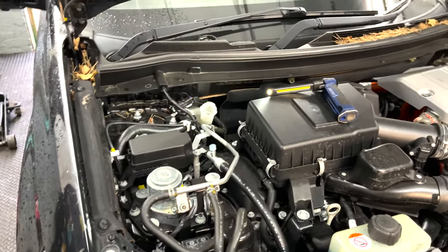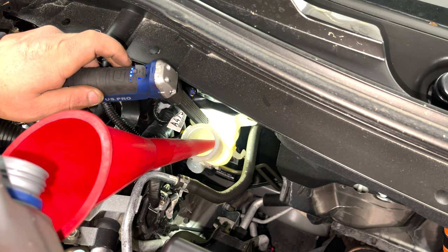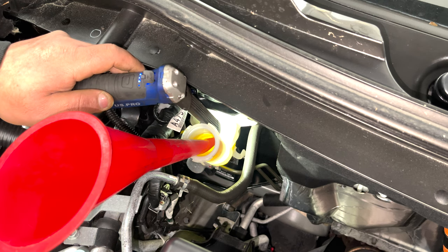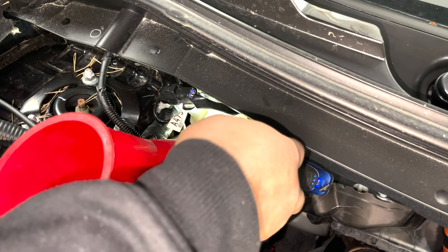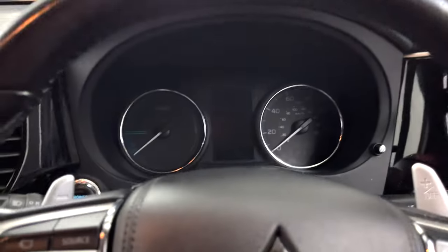I was thinking about a brake pad wear sensor, but I don't even know if this car has one. But we're going to top it up and see if we get rid of that warning. I don't want to fill it up too much because obviously changing the pads will raise the level a little bit. Just before changing the pads, at least we know this was the issue. It's quite a big reservoir actually. Alright, that will do for now - it's kind of in the middle now, definitely above the minimum line. I want to see if that warning is going to go away.